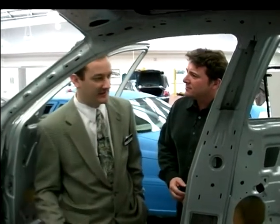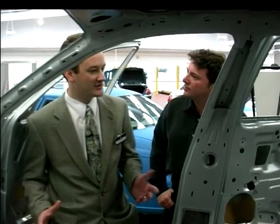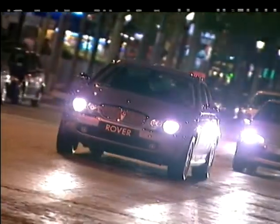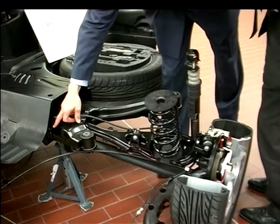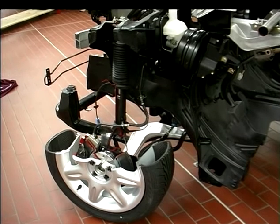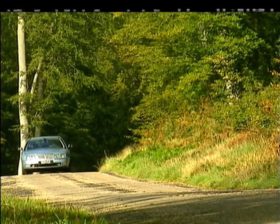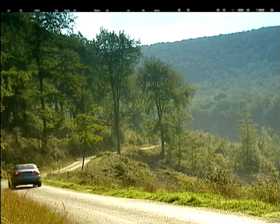Body stiffness — what does it mean? We can think about that in two ways. First, the global stiffness of the body structure and the way in which it can resist forces that are looking to twist it or bend it — forces you might get from running over a bump in the road. We can also think about local stiffness effects, which is really trying to get areas where the engine mounts fit or where the chassis fits to be as stiff as possible, so that there's no creaking or rattling. Having a stiff body allows the chassis to behave properly because the chassis is reacting all its loads against a very stiff structure, rather than against something that might actually move itself.